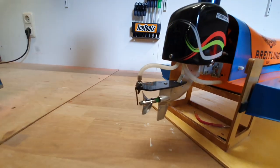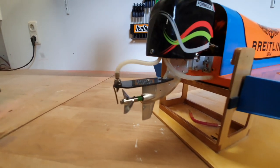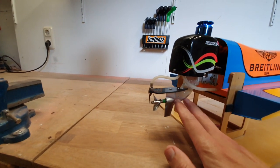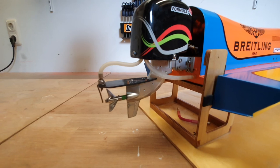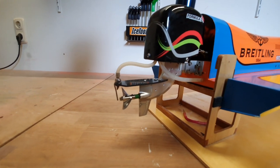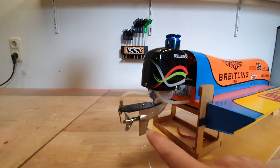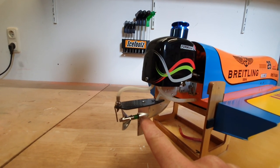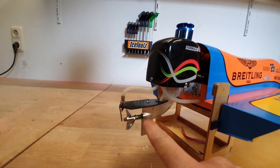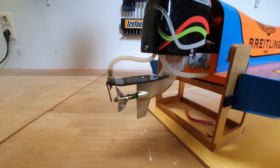I use a small prop saver — just a metal wire — to prevent losing the prop if I break the flex shaft. I made some modifications on this outboard to increase performance and make it more durable, because the stock mini TFL has an issue with the bushing inside. It doesn't last long, so I replaced it with two separate small bushings, and this solves the issue. Now it works really well.